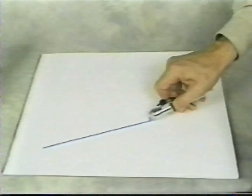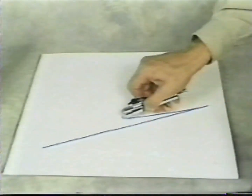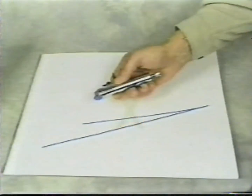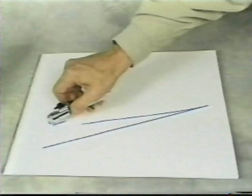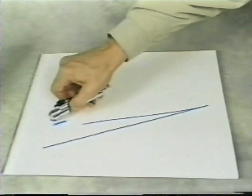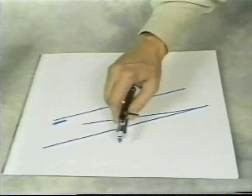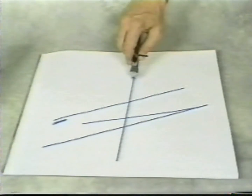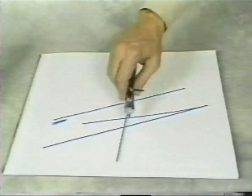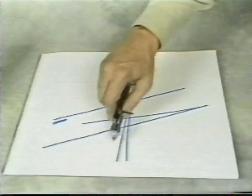The Beugler tool should only be used with the wheel rotating in this direction. Reversing the direction results in paint buildup at the base of the wheel. If this should happen, wipe clean. Before striping, prime the tool with a couple of short strokes, which coats the wheel with wet paint. Place the wheel down firmly and pull, rolling the stripe on your surface. Always keep the wheel flat to the surface. With a twist of the wrist, a curving, even line can easily be applied.